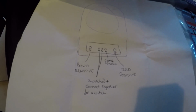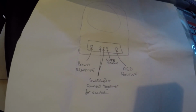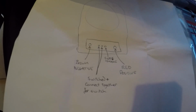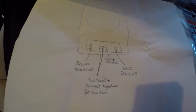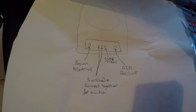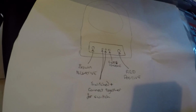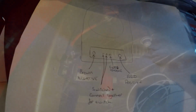As I say, I'm alright because I'm on the standalone ECU, but if you're on a stock ECU, yeah, just see where you can find. Or it could be you do an inline switch, do it off of like the fuel pump or off of any kind of positive, and have it so you can start the engine and then turn the switch on to start the power steering then. So at least you can disengage it if you've got a low battery or any issues like that. So they're just my thoughts anyway, just rambling, whatever you want.